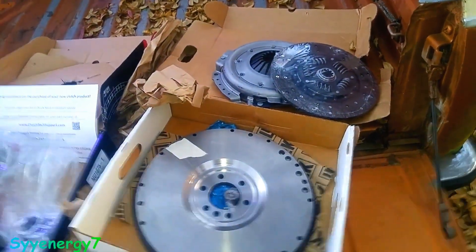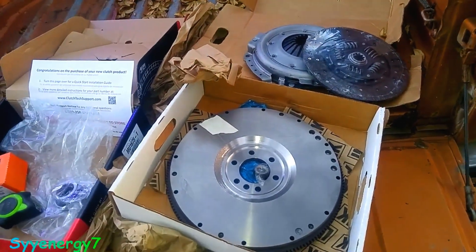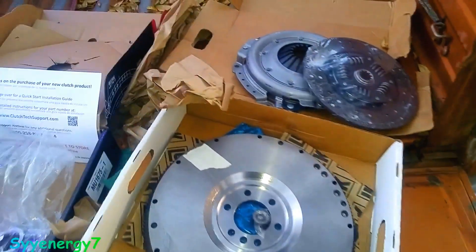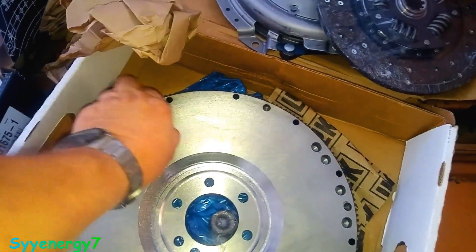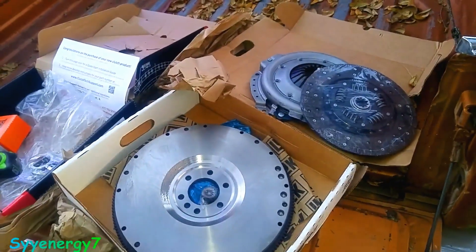Yeah, that's a bummer. I figured I'd check this first beforehand, because getting under the car and finding it doesn't fit would be worse. I was going to count the number of teeth, but it would be 168 — I should have a 153. I only got a 305 engine in there. I knew it wasn't the bigger flywheel, I knew it wasn't the bigger clutch, so I need to order another flywheel.